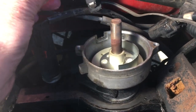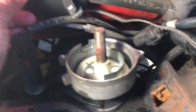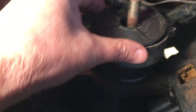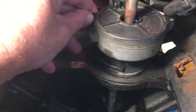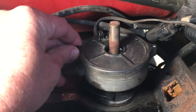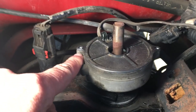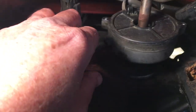I'll go into more detail later — I just wanted to show this distributor and the cam sensor inside. So what I'm going to do is put this cam sensor back down here, and it's held in place by the distributor cap, so when you put the distributor cap down the cam sensor is automatically locked in place. The distributor cap is keyed because there's a square here and a round part over there, so you can only put the distributor cap on one way.